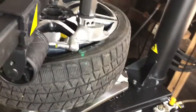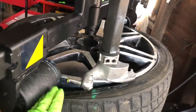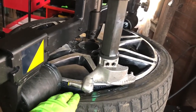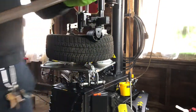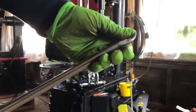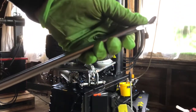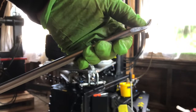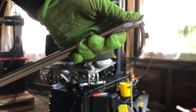Next what I'm going to do — because this is pressing down and these have a stiff sidewall — it's hard to get a pry bar underneath there, so I'm going to use this roller to help me get underneath the tire so I can pull it over the duck head. If you look at the levers, there's two ends: there's a sharp end and then you've got the gradual spoon. I have found that the sharp curve end actually makes pulling the sidewall over the duck head easier.